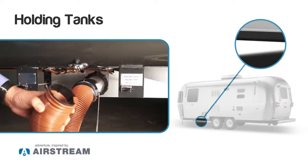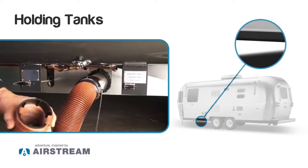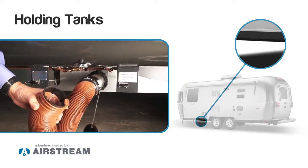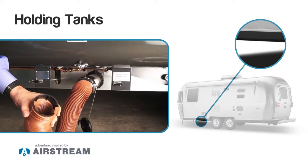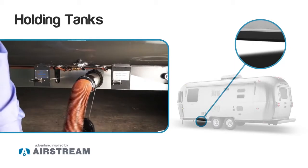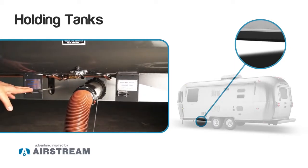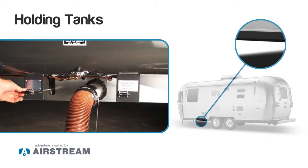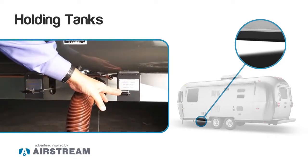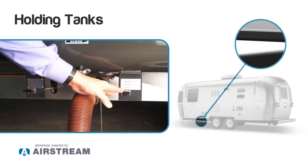Then you're going to take the other end of this hose, and you're going to be putting it in either the site dump or at the main RV lodge dump. We want to always dump the black tank or the main holding tank first. That way when you're done, any solids that are left in there will be flushed out with the gray water that you have in your auxiliary tank.